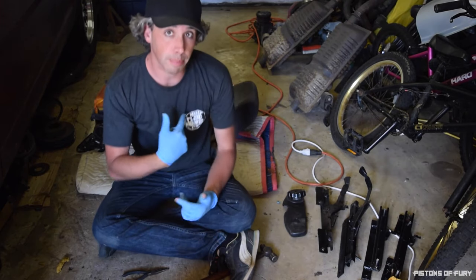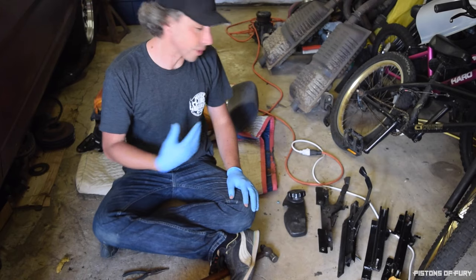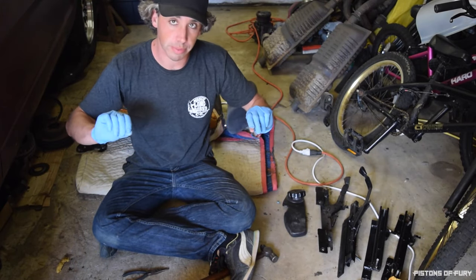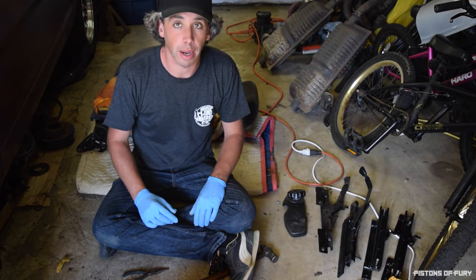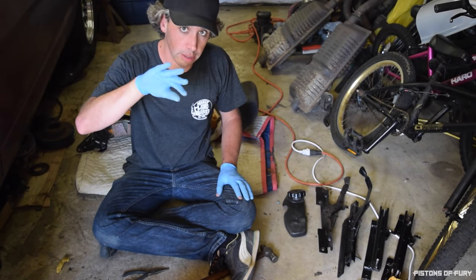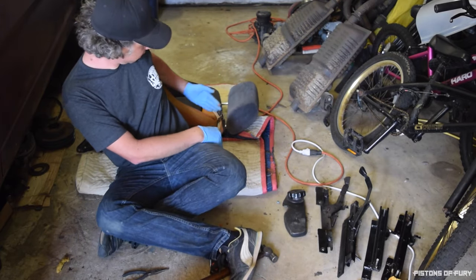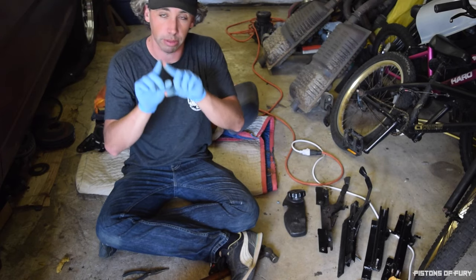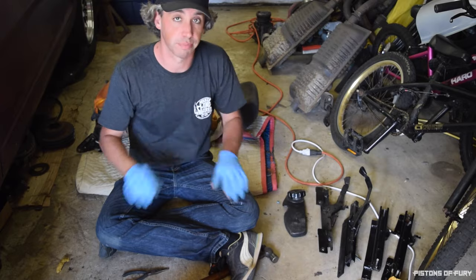Okay, so the bolster in the top half of the seat is actually all one piece that goes all the way around. To get that out, it was just a series of more trim that folds up under plastic lips, so you just kind of have to look and pry around. There's no big secret to it. But it's actually all one piece, goes all the way around the top and the two sides, so I'm going to have to cut. I think what I'm going to do strategically is cut along this seam, right as the two pieces of fabric come together and make it align. So I'm going to get a razor and cut that off.